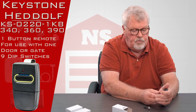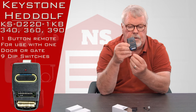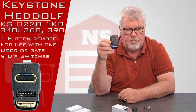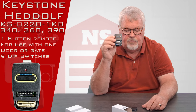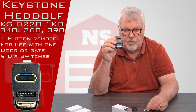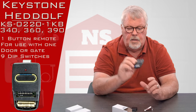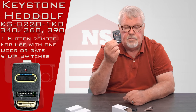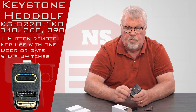There's a little trap door on the bottom that comes off, and you'll see in there the battery. The battery comes with it so you don't have to go out and buy anything. You'll also see in there dip switches. When you get this product, you're going to have to open up your old remote control, or go to the radio receiver on the door and open it up, and you will see dip switches. All you have to do is set the dip switches in the new one to match the old one and it should go to work for you.